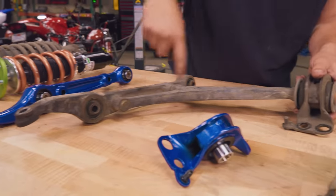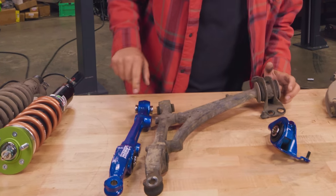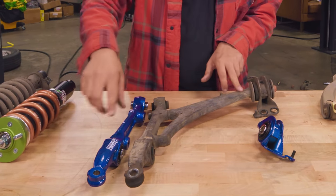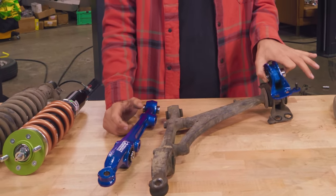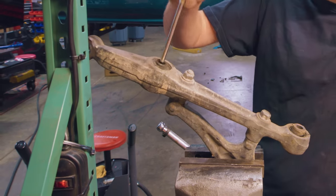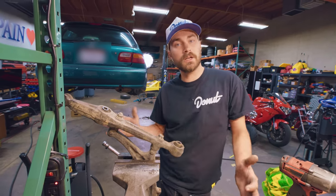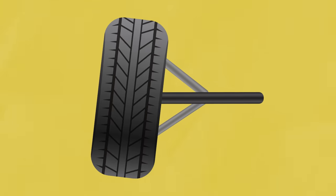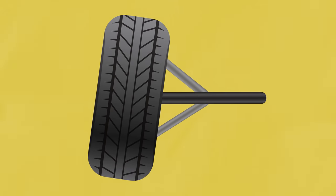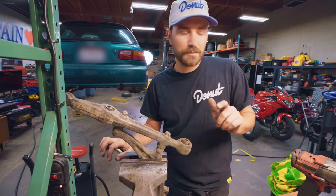This is the stock control arm setup — you can see rubber bushings in three places, one of which is totally gone. We'll be reusing this arm but replacing the outer arm and this bushing. I was just looking at our blown out rubber bushings. They're cheap, good at reducing noise, vibration and harshness, and they wear pretty well. But you can see how much they move, especially when worn out. That causes a lot of deflection and twisting in your suspension and changes your suspension geometry when you're in hard corners, which is really when you want it working the best.